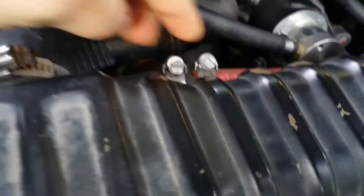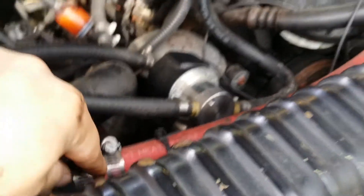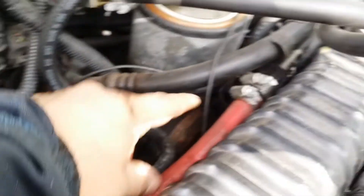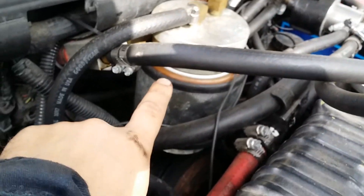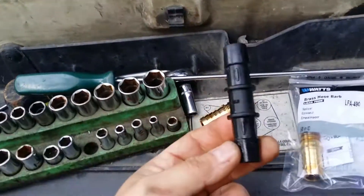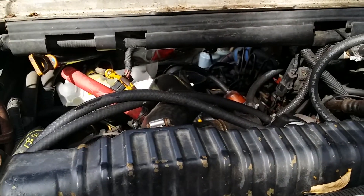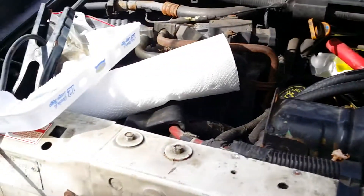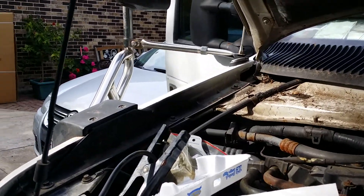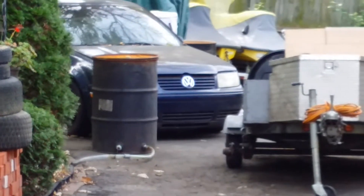I have this special hose here because wherever it goes over there, since this thing runs on alternative fuel besides diesel, I use this hose to continue running — to heat up the filter. Anyway, keep in mind to replace these. They did fail me once on the 7.3 diesel and also on my TDI over there.